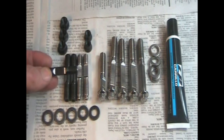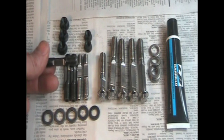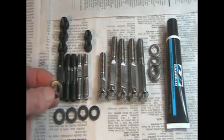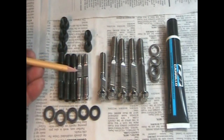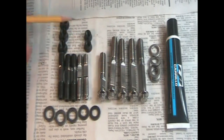We're ready to assemble the head. These are the 3/8 studs that screw into the head. You can see that they're machined or fluted on three sides. They're triangular in shape so they locate the head with the cylinders, but they also allow the bolt to stretch so it stays tight. We have conical spring Belleville washers for the studs. These are the two 5/16 studs that go up near the pushrod tunnels — fluted so they'll stretch and stay tight. Same with the head bolts. These are 12-point nuts with lubrication for the threads. These are high strength aircraft aluminum pushrods. They're the same weight as stock pushrods but lighter than steel pushrods, allowing for high RPM and helping eliminate flex.